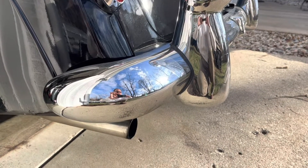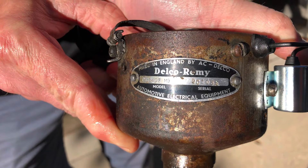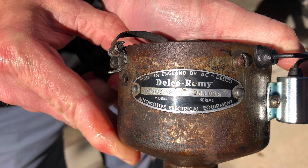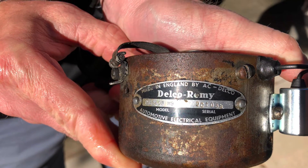From the back on a cold start, it is still hacking and coughing. Based on what we saw on the oscilloscope, it looks like something is a little off in the distributor, so we're going to dig into what might be going on in there.